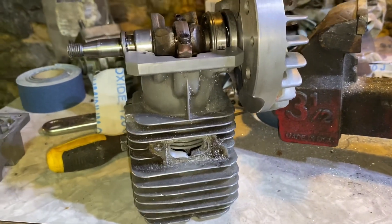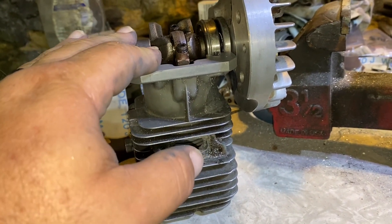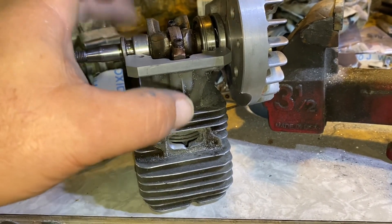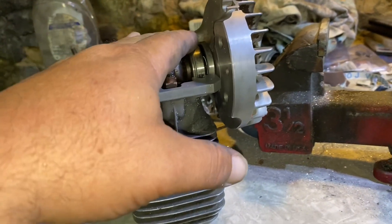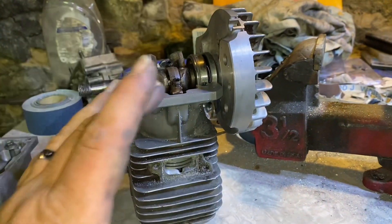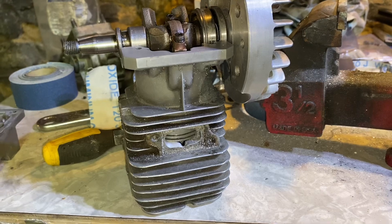So there's what she looks like right now. Squish is sitting at 30 thousandths. I'm at that point on the squish that I had to start getting in and doing the fine tweaks on the bearing pockets, making sure they're all lapped in nice and neat. Because from here out, it is very small adjustments and I just want to make sure everything stays right. I'm making extremely small adjustments at this point.